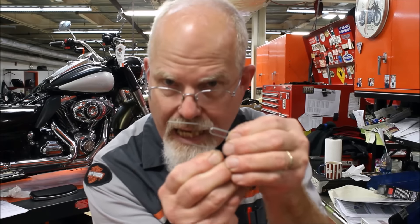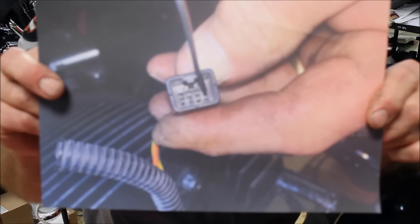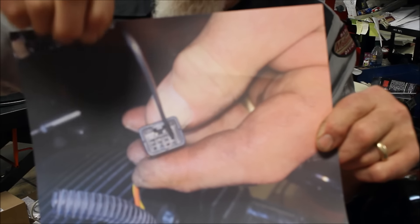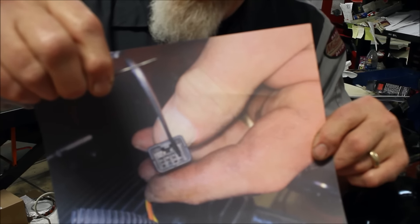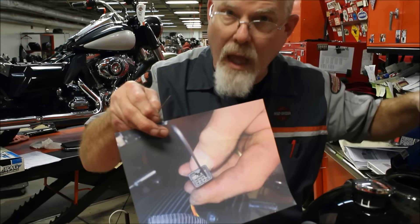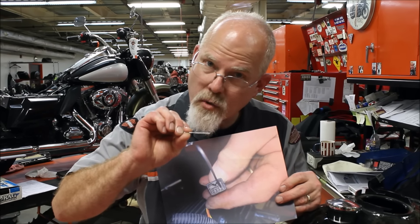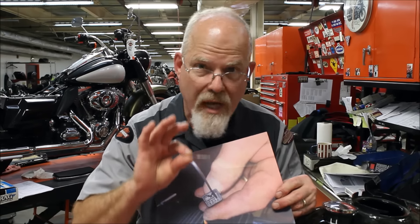The reason you want that bevel is so you can insert it into that black square. There is a clip inside — you feed the paper clip in, feel it, and press it away from the pin, the electrical connector. Insert it, then bring it down, and at the same time you're pulling on the back of the wire. The minute you get that clip out of the way, it will pull out. It takes practice, it takes a feel. Make yourself a tool that fits inside those little squares, insert it, feel it come to an end, push just a little bit more, then down, and pull on the wire. It will come out, I promise you.